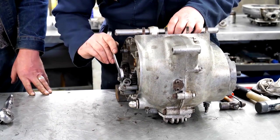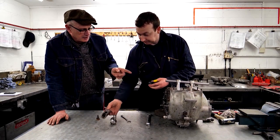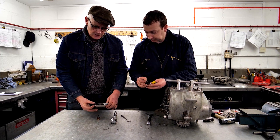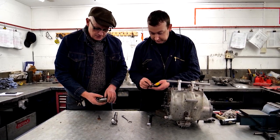It's a tricky thing to get the pinion off if you don't have a puller. It just has little slots in the side. This tool has been made up to fit into those slots, but without it people tend to try and lever it off with a screwdriver, which can easily break or chip the slots and do all sorts of damage.